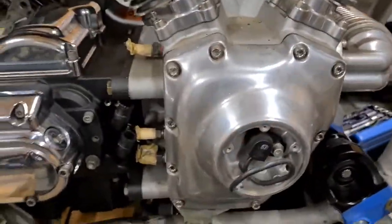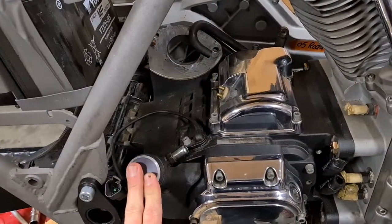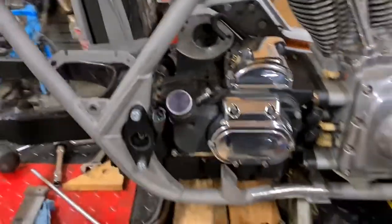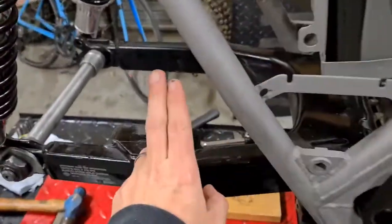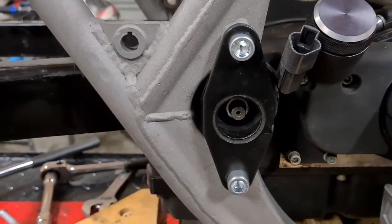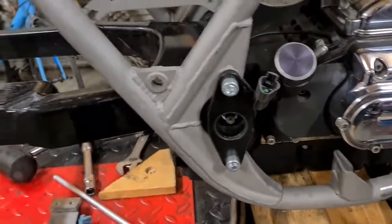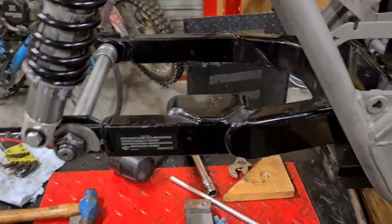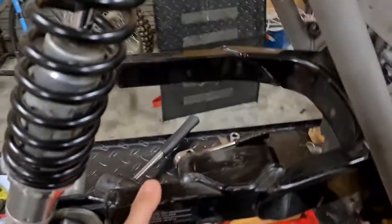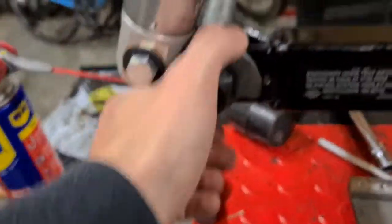It has a cam sensor that is not needed and will be going in a bin. It is mounted to an O2 transmission - five speed still. This is from a Road King, so it's a Touring transmission and Touring swing arm. I think it's a three-quarter inch pivot through your transmission and swing arm, unlike the Evo which is a little bit smaller. Your swing arm for an O2 Road King, or the FL swing arms in general, are much, much beefier. You've got your concentric adjusters there as well.